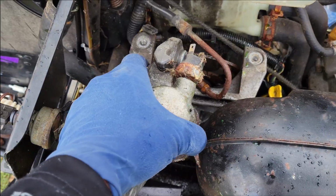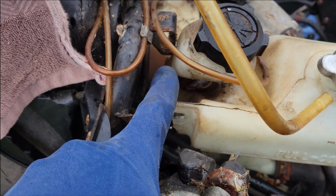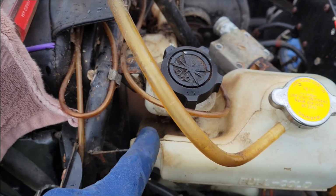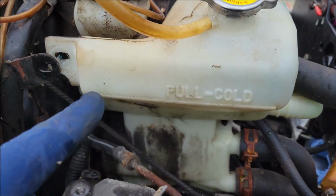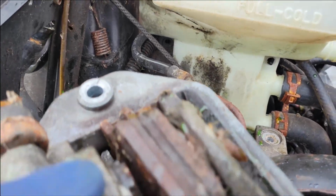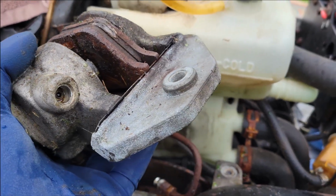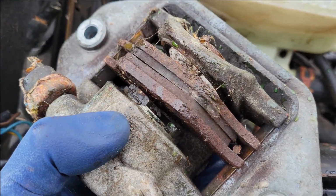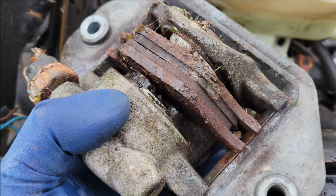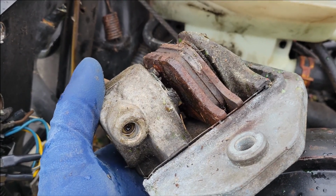And then we'll move forward. All right, so I was able to get the caliper out, guys. What I ended up having to do was take the bolt out of the back of the oil reservoir there and lift the reservoir up out of behind this here, and it allowed me to push the coolant reservoir up just enough to wiggle this whole thing out. Then of course it was attached to the brake line, so I went ahead and used 11mm, which is probably also like a 7/16 or something, and got that out. Now again, we know that the piston is moving, so that said, we know it's not bad, but it might need a little bit more help being freed up. So I'm gonna go ahead and fill this thing up full of penetrant and let it sit overnight while we order our parts.